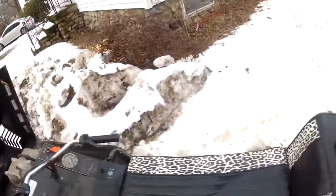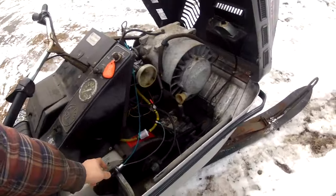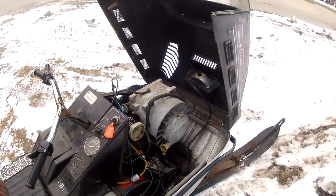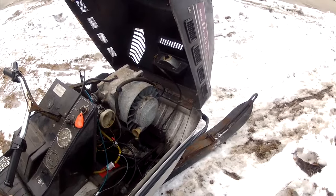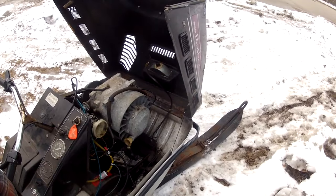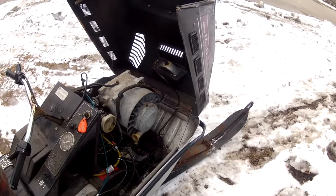If we go over to the other side, something I've written about a long time ago is my primer setup. These can be hard to start because they're relatively low compression, so the primer really helps in starting it. Today I put in a fuel shutoff. I don't know how happy I am with that configuration. Previously the fuel filter was hidden under the console, and it may have been that way for a good reason — I may shorten that line and put it back there. But anyway, with the new crank seals, this runs great and I'm super excited.